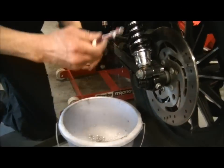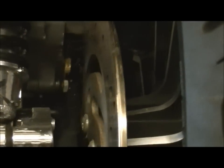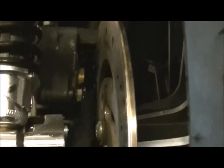Right, same drill as yesterday. In there with the old toothbrush, and get yourself all around the gum line there. Clean off any of that crud build up that prevents the piston from moving back. On this particular caliper there is just the one, a single piston floating caliper. And to get underneath, you can indeed get up. No, you can't. So you get at the back of it. There you go. See? Sensodyne toothbrush gets down the back of it. It can reach the back teeth. Hard to reach areas.